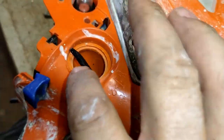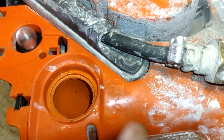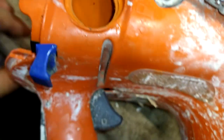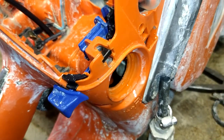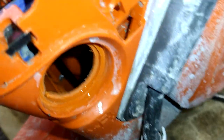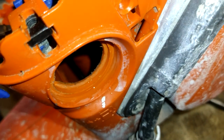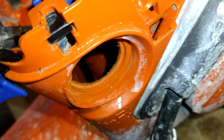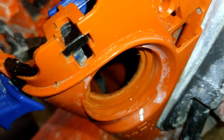Now we're going to cut this tip off so it's flat, then we're going to stab a fuel filter on the bottom of it, just like that. Then we're going to shove this back down into the tank and make sure that it's laying on the very bottom. You may have to take up some slack — pull it back this way or whatever — just make sure it's laying down in the bottom of the tank. There we go — that's what we want right there, that bugger just hanging out down there.